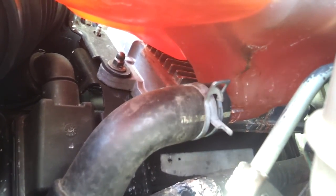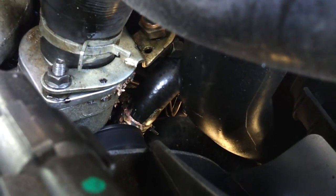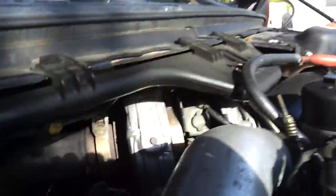There's a pinhole in my degas bottle dripping down onto the hose there. The seam is leaking. That's a third thermostat O-ring. And that's a nice lovely leak at the seam on my radiator.